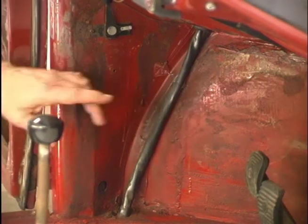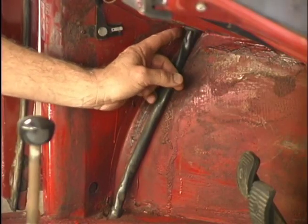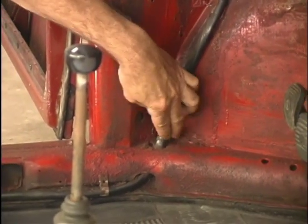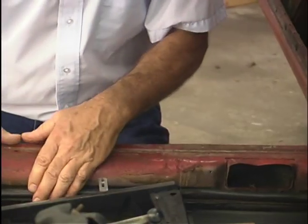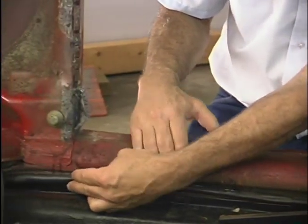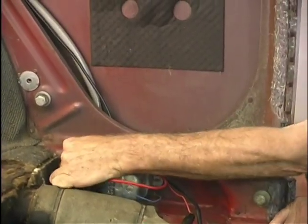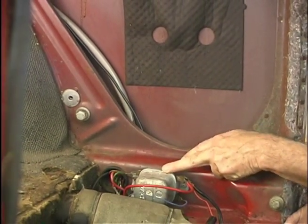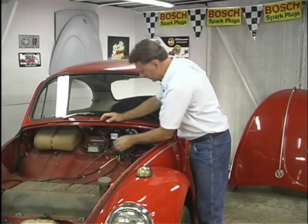In 1965, they made the windows bigger, which made the window posts smaller, so you could no longer run your wiring harness up through the roof. On '65 and later bugs, the wiring harness goes through the floor of the trunk, behind the hood spring on the left side, then through a rubber grommet at the bottom of the trunk, in behind the carpet on the left side kick panel, through a hole in the heater channel, then follows a groove down the side of the heater channel held by metal clips, all the way to the back and up through a hole in the quarter panel. On '67 and later cars, the voltage regulator is on the inside of the car.